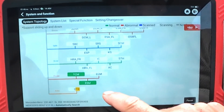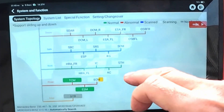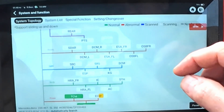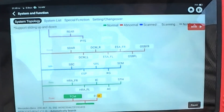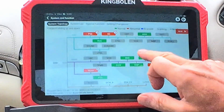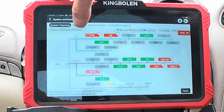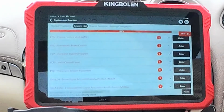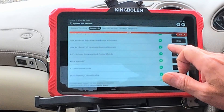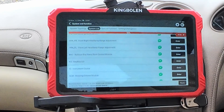I don't actually have the distronic - it's got the power functions, your TCM, your ESM. As you work through you can see it's grouped into areas - for example, safety has got the SBC sensotronic brake control and the ESP which is your electronic stability program. If you want to get an idea of how long it's got to go, go to the top and press system list. Here you can see it's at 86 percent - the ones in red have faults, the ones in green have a clean bill of health.